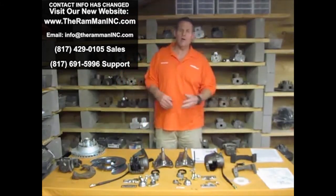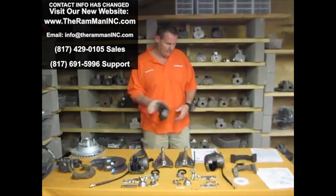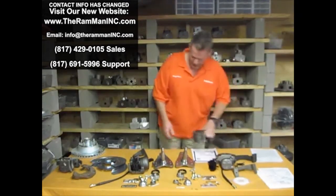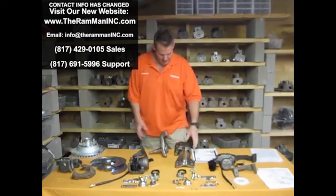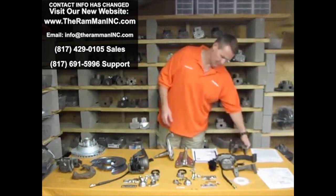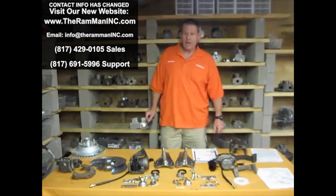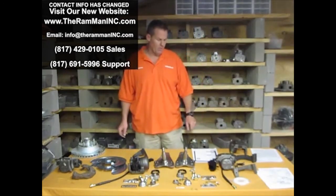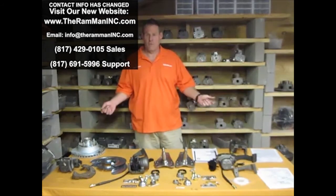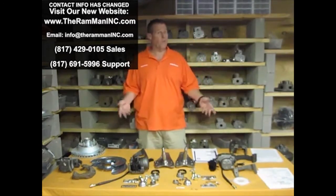What most people don't know is that Chrysler did design a sliding caliper to be mounted in the rear — this is the example right here. You'll notice the bleeders are in different spots; it's a different design. So for those difficult situations, they're factory designed to run the calipers in the rear, if you would prefer — some people prefer that over the front, for an added cost. The factory setup is basically 11-inch rotors across the board, and this will fit all the factory wheels. These front kits came on 14-inch wheels from the factory.